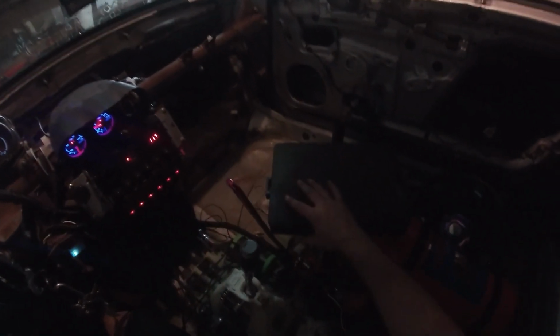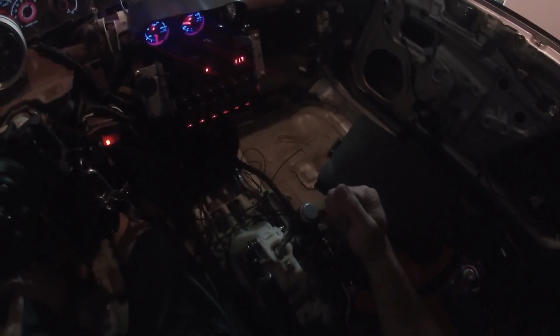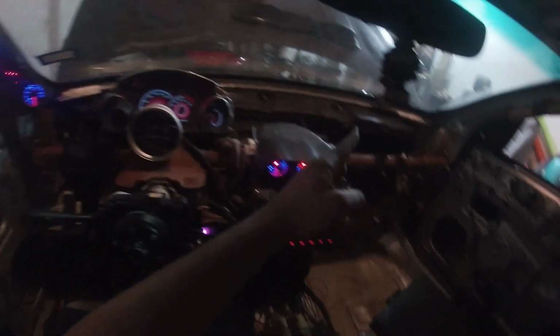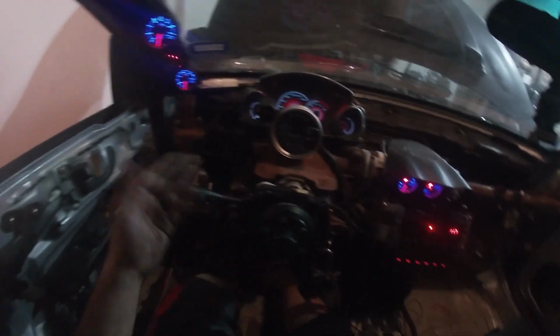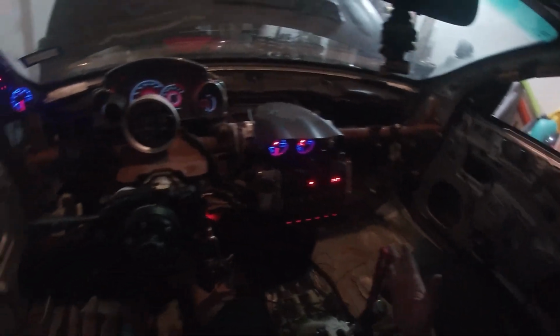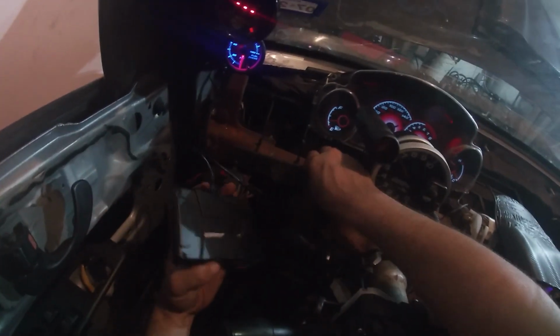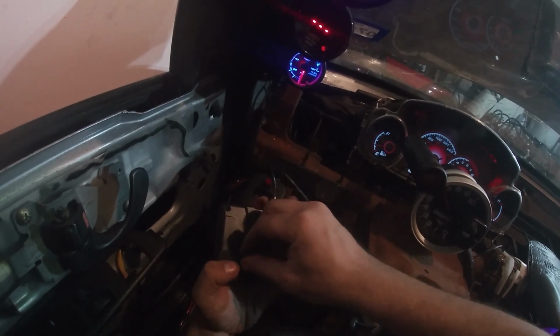On the trans brake, or it's a hydro brake technically, I did install a switch down here. So when that switch is activated, now the 2-step is active and it's killing the nitrous signal. So it's sending a signal to the controller saying, hey, don't shoot nitrous. So as soon as this thing lets off, nitrous and launch happens at the same time. Nitrous and 2-step turns off.